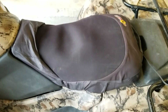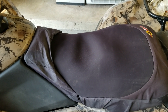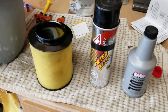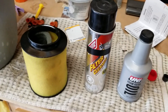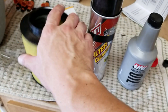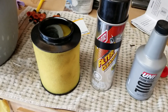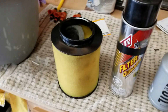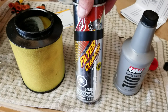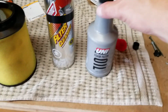That is replacing the air intake filter. These filters you can normally clean after you remove them — you don't have to replace them. This one I had to replace because it was old and split. But if you wanted to reuse one that's still good, it's very easy to clean. You can buy filter cleaner from O'Reilly's, AutoZone, or any auto parts store, and you'll also need foam filter oil.